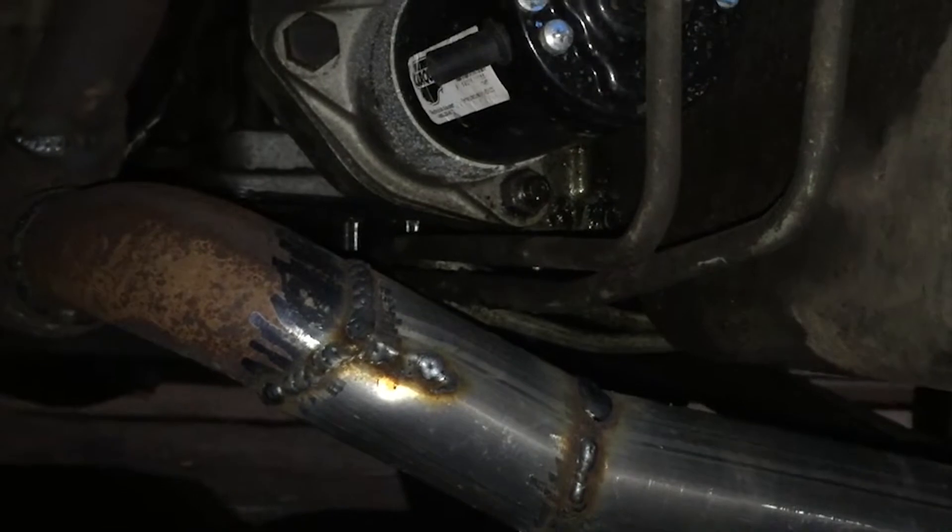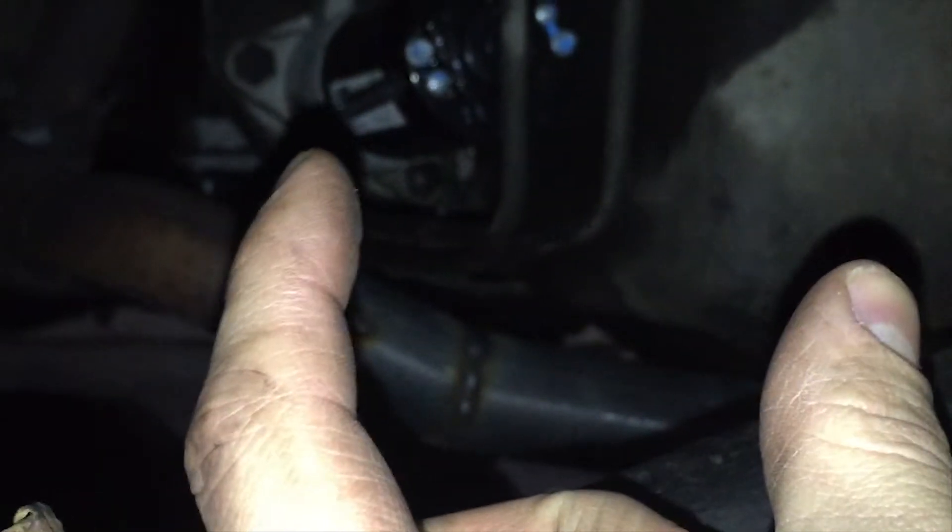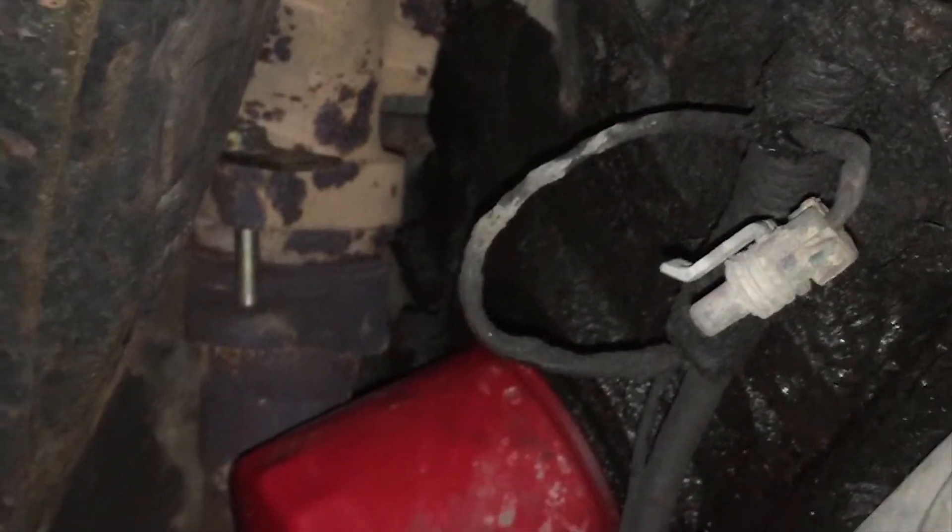I don't know why, but I think it started causing a problem. So when that got smashed it basically pulled the two pieces of the y-pipe together a little bit, and they were leaking up at the manifold on both sides. I could see basically the black from the carbon, the exhaust leaking out.